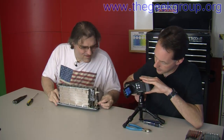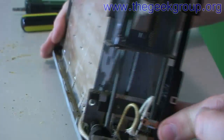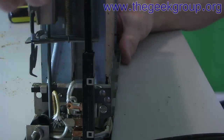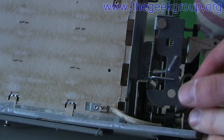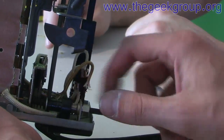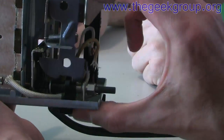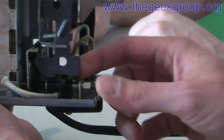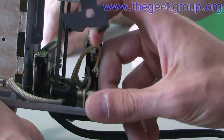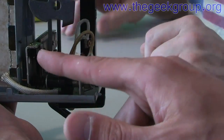Getting some video in here so people can see what we're doing. Got the trap door closed. Here's a switch that turns it on and off. When you push down, it engages that switch. There's a little cam and a little lock. The cam sets how much time. There's a little bi-metallic strip. You turn the cam and it moves this spot in and out. When this goes down, it pushes how much this has to move. When this comes out far enough, it pops up — you get your toast. So this moves, this heads that way, and this gets further that way as it heats up.